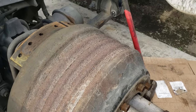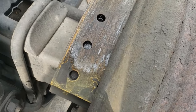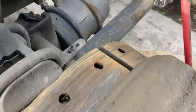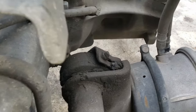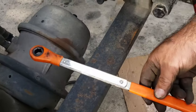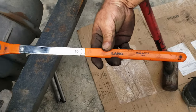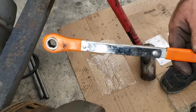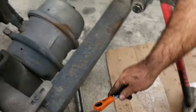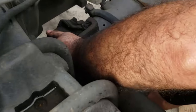In case your drum doesn't want to come off, you're going to have to loosen your slack adjuster. We're going to be using this wrench. That's the model number. I'll leave a link in the description in case you want to buy one. You can also use this one to adjust your slack adjusters, your brakes.